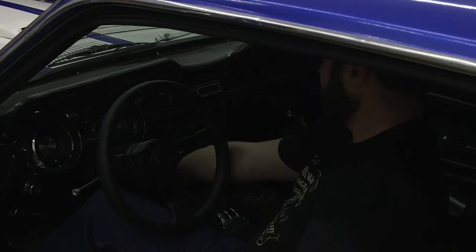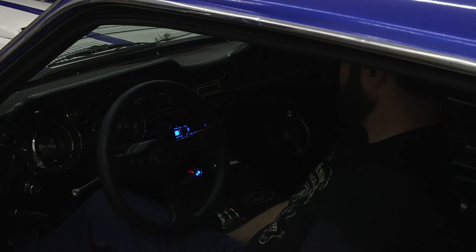This can be beneficial if, for instance in this car, you wanted to prime the fuel pumps when the door opens to make the car feel more OEM and easy to drive. Typically in this application you would have to get in, put the key in the ignition, turn it to the on position, wait for the computer to boot up, wait for it to prime the fuel system and inject a small amount of fuel, and then you can crank the engine. That's not very handy for people who aren't familiar with the car, or if you're in a hurry.